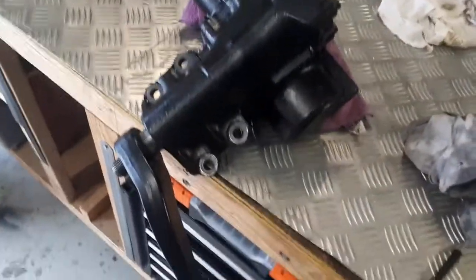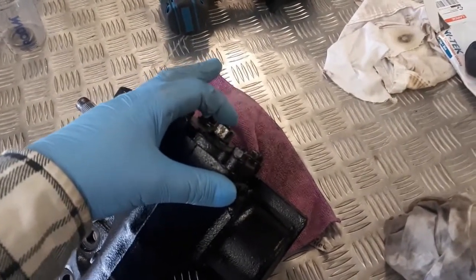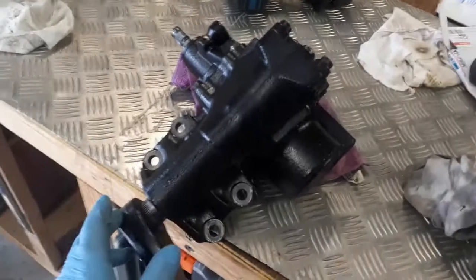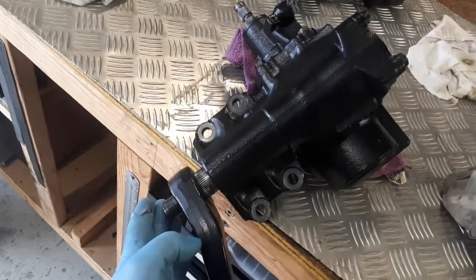It's surprising. If you tip the thing upside down to do that, the top of the sector shaft, the thread will be sticking out, and you'll bugger it because you'll be on the surface. It won't be level. You can probably maybe put a couple of bricks either side, but you're taking the life in your own hands there. That's all I do. Undo the nut so it's level with the thread, so you don't bugger the thread, and take that top off. A couple of hits with the hammer, and mate, they just pop off. It's quite surprising.